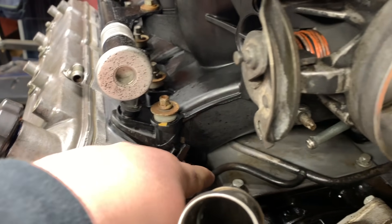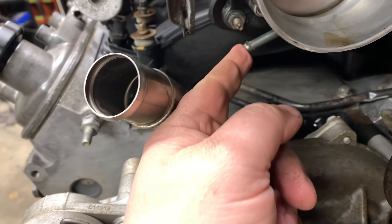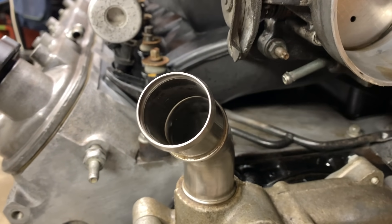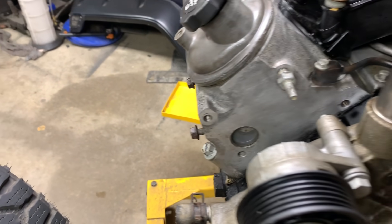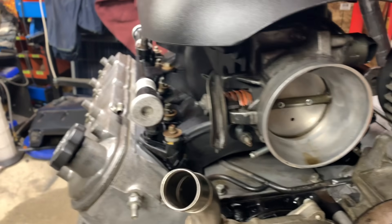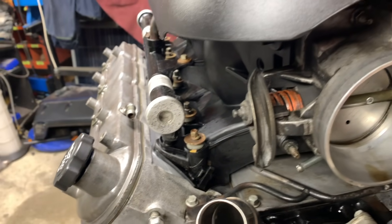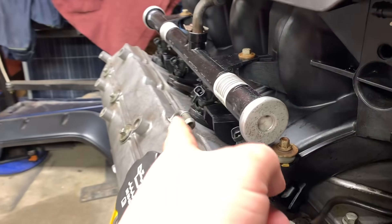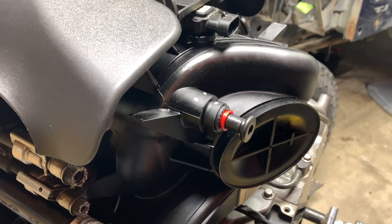These lines here — I guess those are steam lines. It connects to the throttle body; I blew air through it and it comes out the bottom one, so they're connected. This one connects to the coolant system — it's not plumbed into the water pump. I can probably go to a heater hose somewhere in the system. The throttle linkage — I thought the cable would connect here but I need to use a different piece, so I might head to the junkyard tomorrow to get a throttle cable. There are also vacuum ports I need to identify, and the plug in the rear is what I need for my brake booster.